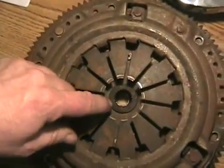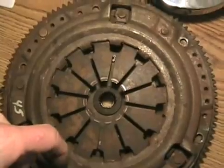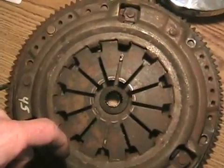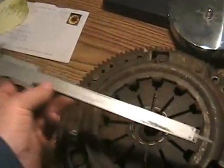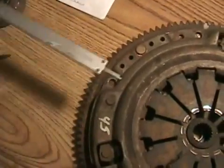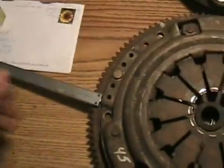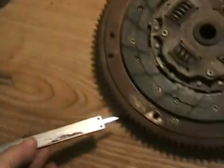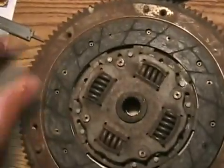Close one eye and look straight down — get the two circles perfectly concentric and in line. You can actually line up your clutch disc without any special tools or procedure. Once done, tighten all the peripheral bolts until they're very tight with no gap on the pressure plate. Another method: find a spot on the edge of the pressure plate, use a tool to measure the depth to the friction disc, then go around measuring from the outside until you get the same depth all the way around — that'll center the hole in the middle.